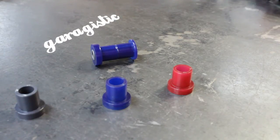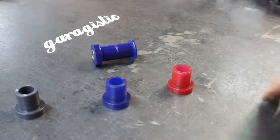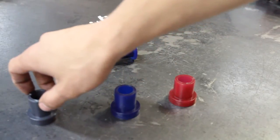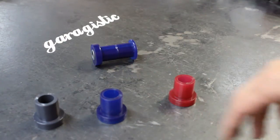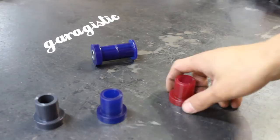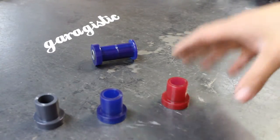What we've got here are the flavors that we usually do all of our poly bushing kits in. You've got your 80, your 95, and your Delrin. Delrin being your all-out race application, 95 being a little bit of dual purpose — a little bit more emphasizing performance than comfort. Then you've got your 80, which is basically your autocross comfort and a great street application.